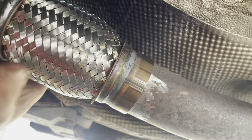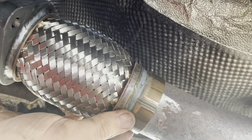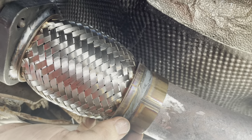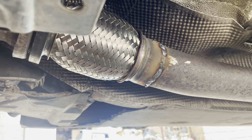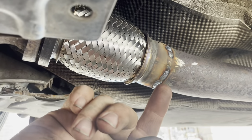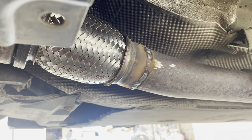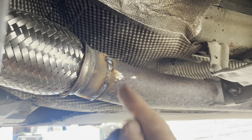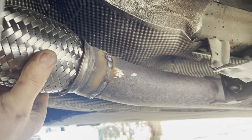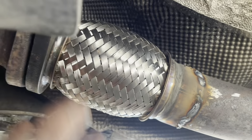Now, if you didn't have access to welding gear, you could probably put a sleeve or a clamp on there - just cut a couple of slots in there - but welding it up for me is the more permanent repair. This is by no means the prettiest welding I've ever done, but it gets it tacked in place. Obviously we need the seam around the whole repair section. What I'm going to do next is drop those bolts back out and drop the exhaust back out to give myself more access, so I can actually get the whole thing welded all the way around. Because with that now in position, it's not going to move relative to this position of this mount and bracket here.